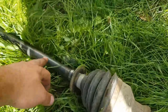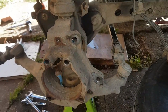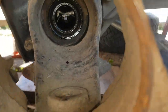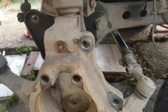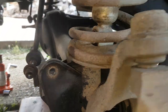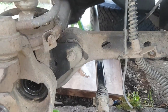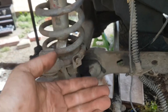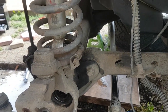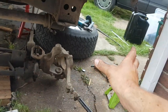That's nice and smooth. We're basically not far from dropping this axle. Looks like that seal has gone. All bolts are undone that I'm aware of, this fluid has been drained, shafts are out, these bolts are out — the only thing really holding it in place now is the stands. I won't be able to film and get it out myself, so the next scene will be on the trolley jack. I plan to use the trolley jack underneath to lift up and then in theory pull out. And that's the axle out, on the floor.